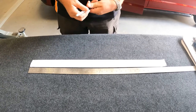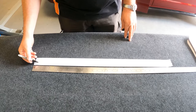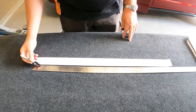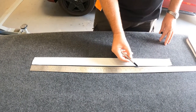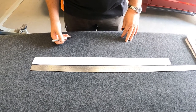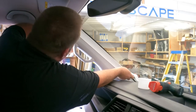We've got 50mm masking tape here — it doesn't need to be millimeter perfect. We're doing this on the near side, which is the passenger side. From the windscreen, come in by 40 millimeters — so 10 millimeters in from the edge. I'm just going to do it by eye: the poppers are at 45 millimeters and 10 millimeters in, so I'll put a dot here, and at 580 millimeters come in 10 millimeters and put a dot there. Now we'll put this into the vehicle to fix the poppers.